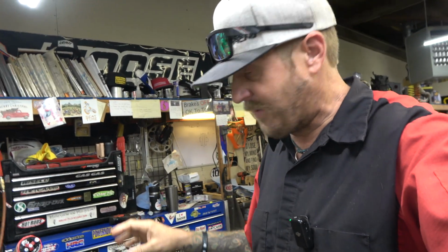The other really cool thing about Dal Soggio is that with just an email, they sent me all the valving specs, like the shim stacks and everything for the Enduro, the MX, and a whole bunch of other stuff. So it's really, really cool. Tons of information. So if you're an amateur tuner or a professional tuner, you can get all the information you need to adjust these things with shims and really dial it in yourself. Like I said before, we will be doing TBT valving to this eventually, but I'm going to test it a whole bunch bone stock because I want to let you guys know what you might get if you just bought them and dropped them in.